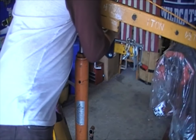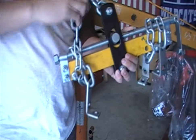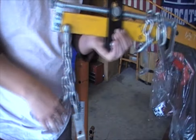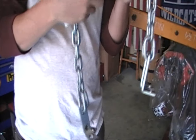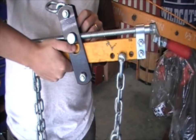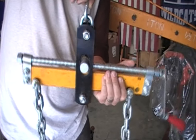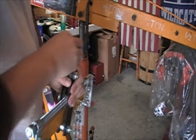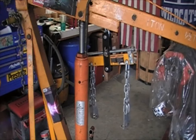The next thing you're probably wondering is what is this thing I have hanging here? Instead of just using a chain, some people like to use a load leveler. It's got four points that you can secure on — two in the front and two in the rear. So say the engine was tipped forward too much, you turn this out and it would essentially level the load, kind of like a scale. These come in really handy. You've also got just your basic chain that you could use, and that works pretty well too.